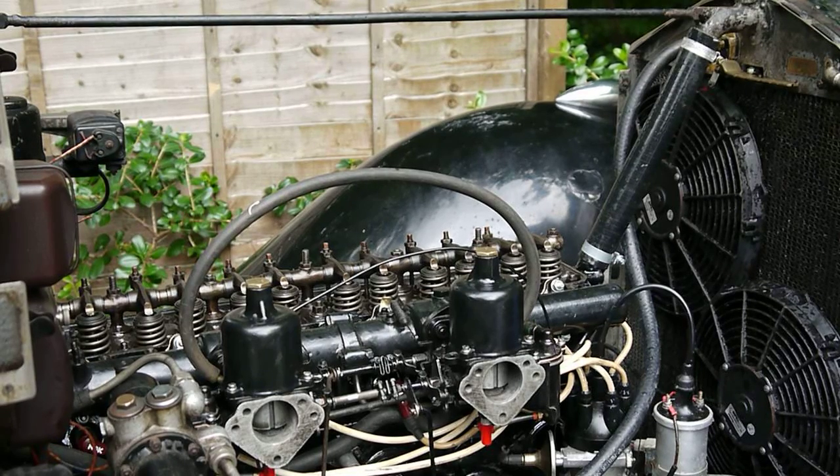Test run of Rolls-Royce 2530 with period Bentley four and a quarter cylinder head upgrade, now fitted with Mercedes valves, twin HS6SU carburetors, electric water pumps, Jaguar electronic distributor, and electric fans.